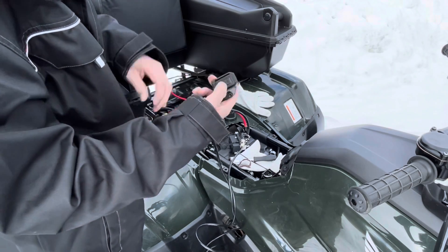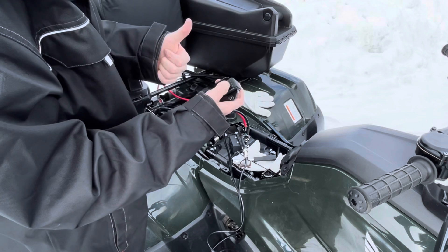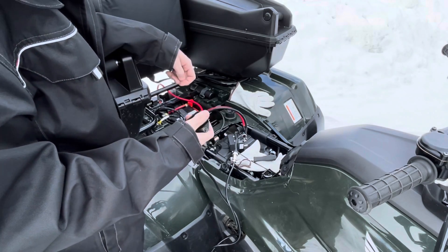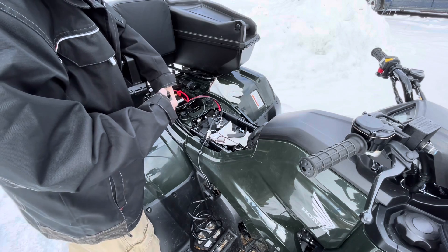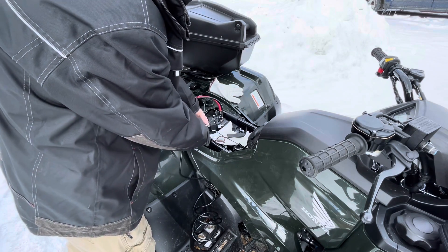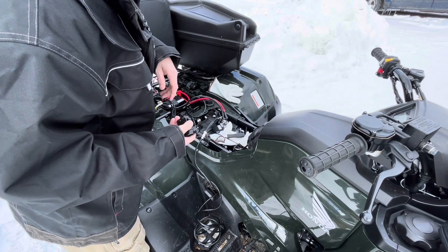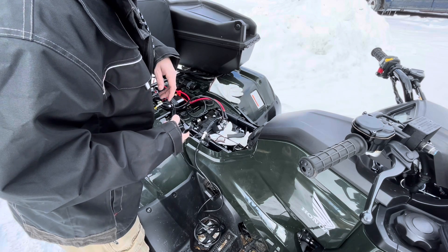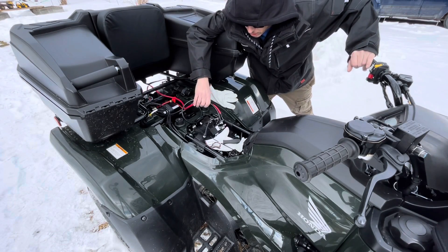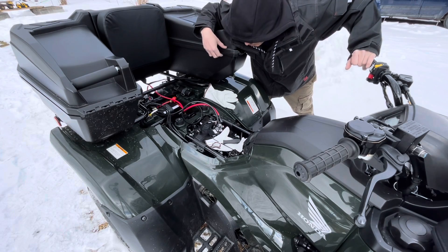In and out — for some reason in is down. That sounds good. You don't want to drain your battery; you should have the vehicle running when you're using a high amperage motor or a winch. I don't even have the winch motor hooked up yet but it does sound okay — it sounds like it's engaging both ways. I don't think it's sticking. I just finished testing this contactor and it seems to be okay even though it rattles, so I'm going to go ahead and wire it up and see what happens.